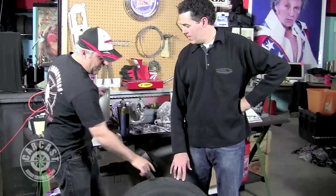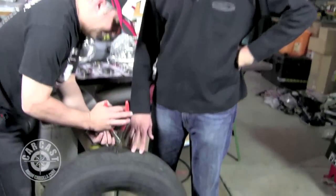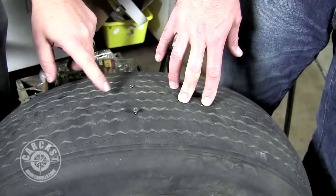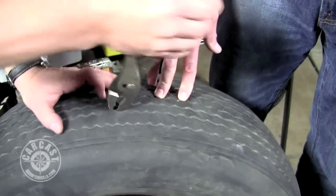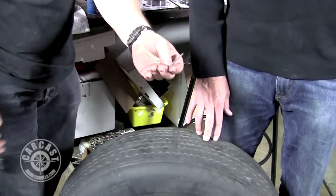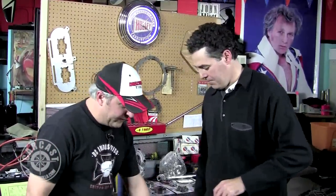Yeah. Anyways, so this is a typical drywall screw that's got embedded into the tire. And the first thing you got to do is get the nail out, or screw in this case. And there's two of them here just to illustrate how bad the driveway is full of this stuff. You're going to have to pull that thing out. If you do get a drywall screw, though, they can be brittle. So what Sandy just did there could oftentimes break them up. Well, you can turn them if they're threaded. Or by the way, if you're in a situation where you got to get going, push it in.